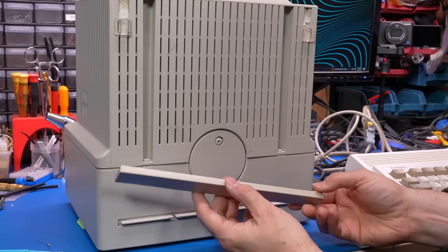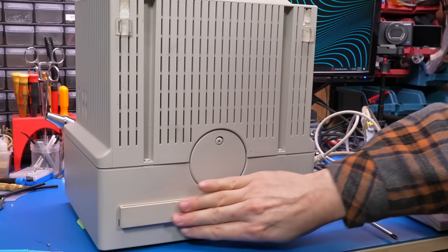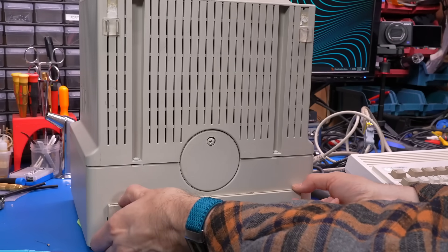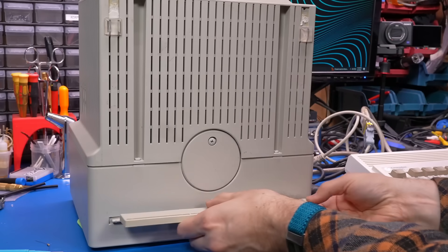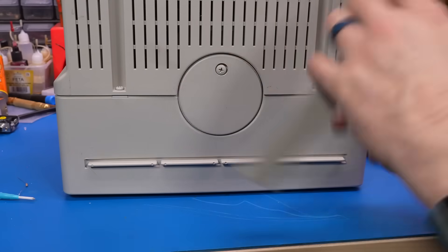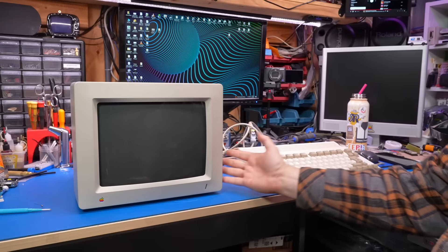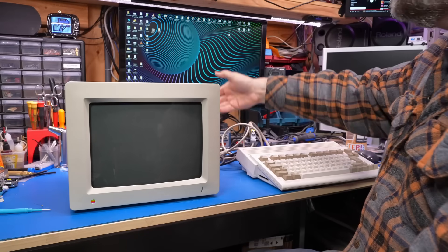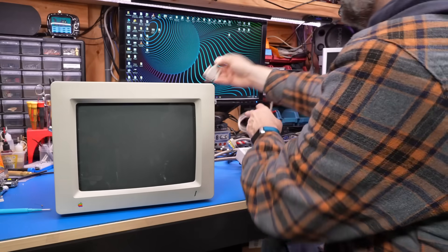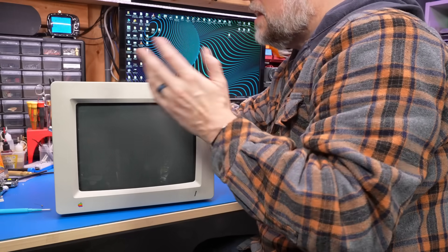While the monitor is on its face, I removed the two rubber feet from the front edge and swapped in a little stand I stole from another Apple monitor — that's the support bar that goes on the front edge and spreads the weight of the monitor onto the Apple IIGS case rather than pushing on just two small spots. You can pull the old piece off and install this one — now the monitor has a little lift, but I actually prefer the original flush position. Then I plug in the power cord and connect the Amiga using an adapter cable that goes from the Apple IIGS 15-pin connection to the 9-pin that the Amiga or the 1084 uses.